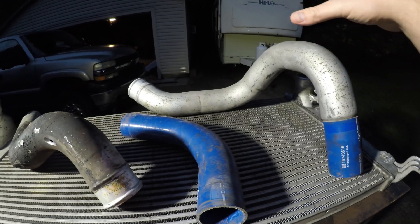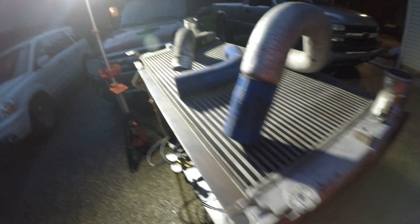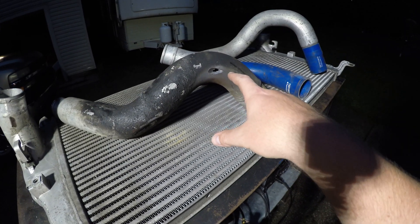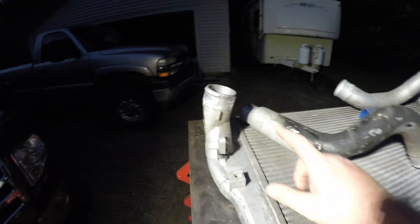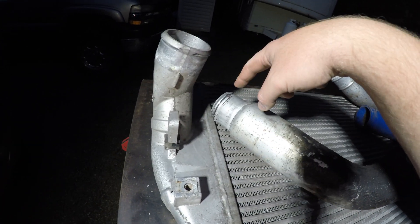I've never had any issues with the couplers or any other things coming apart. It's literally just that there's a hole in this one from rubbing. Everything is still sturdy — no cracking in the intercooler that I'm aware of. If you have a very mild to stock truck, these are great parts. If you take care of them, are aware of this issue, and potentially just change out this one tube, they will last a lifetime. These were removed at 250,000 miles and it took that long for that to happen. The factory intercooler does have three-inch inlets and outlets, so you will need to reuse those couplers because the factory boost tubes are also three inch. They do neck down to two inch at the inlet to the Y-bridge and outlet from the turbo, but other than that, everything is three inch.